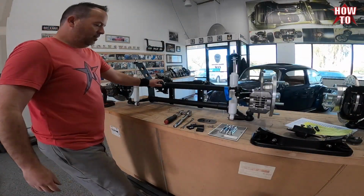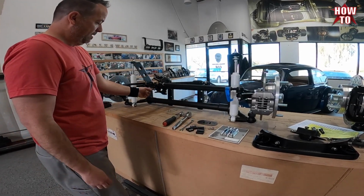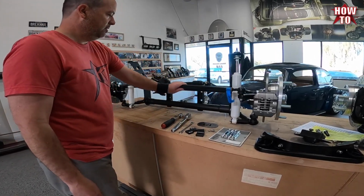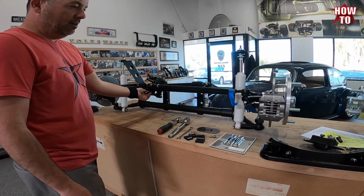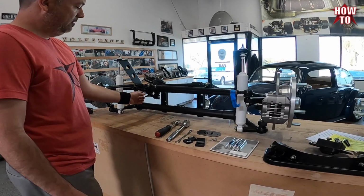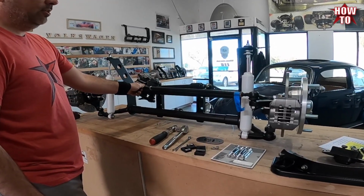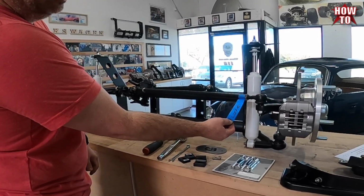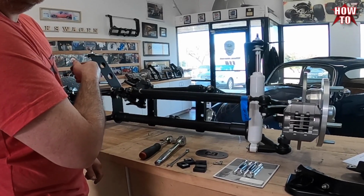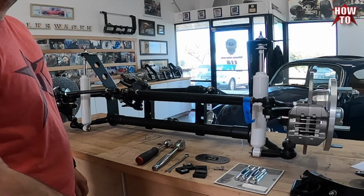Right, first step when getting your PRObuilt beam is you got to take the steering dampener nut off. You got to take this whole long tie rod assembly off. So on a 66 and later, there are 19mm nuts here and a 17mm nut here. I'm going to take off this assembly. We do leave this tag on that shows that it's loose, so that you don't assume that it's tight. I'm going to remove that, then we're going to put it in.